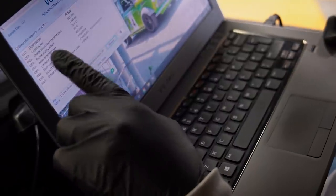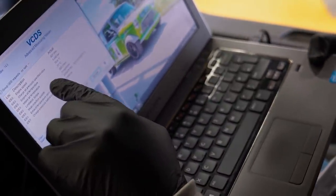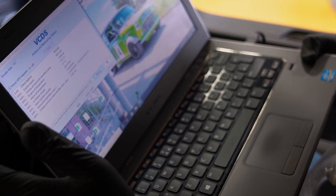These are the basics that I'll be logging. You can see the items on there going through. So we've got the engine speed. We want to see what the turbo's doing, both what the ECU is asking for and what it's actually getting. We're looking at the engine oil temperature, because obviously you don't want to go out and do a full single gear pull if the engine's cold. You need to get up to temperature first of all. Intake temperatures are really important.